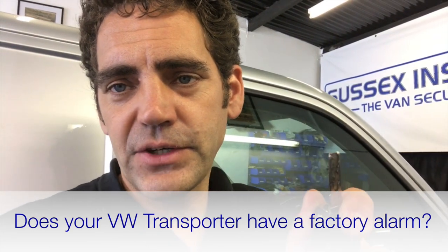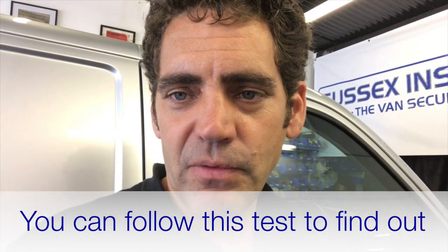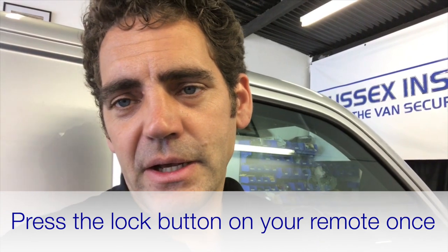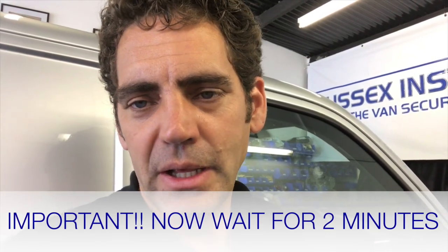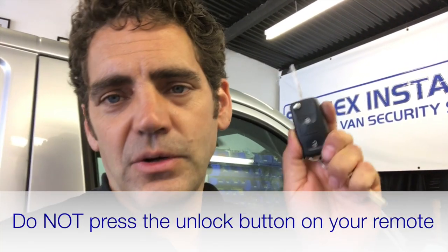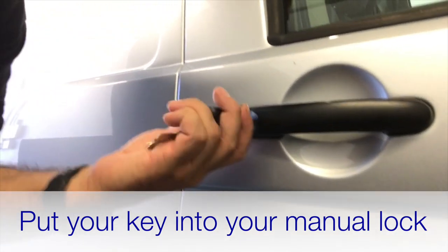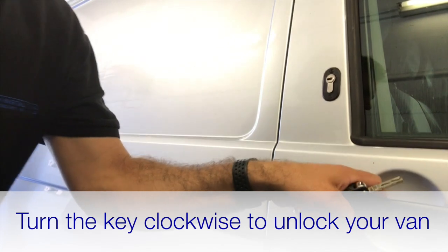...whether you can have this alarm upgrade, or whether you need to purchase a whole new alarm from us: lock your van and press it once. Now wait for a minute — I know it seems like a long time, but actually time it. Make sure you wait at least one whole minute, even two minutes if in doubt. Or if your van's been locked outside your house all day, go out to it now. Don't press the unlock button, don't touch the remote control. Just put the key in the manual lock on the driver's door, turn it to the unlock position, and open up the door.